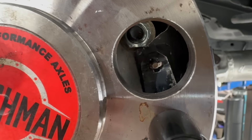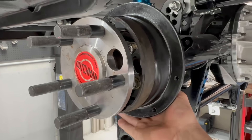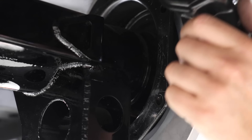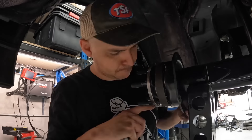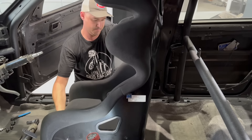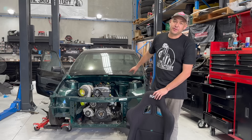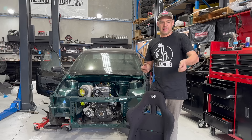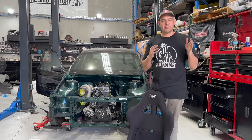It's worked - a little clearance on the shoes and everything's bolted up looking good. Having the car back on the ground is a bit of an accomplishment. There's still brake lines and stuff to get made, but the handbrake works. I also need to fit a handbrake lever and some cables. Being that we've cut out the tunnel, there's no handbrake assembly there anymore, so I'm just going to buy a hot rod kit and maybe put it on the side of the driver.